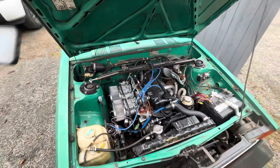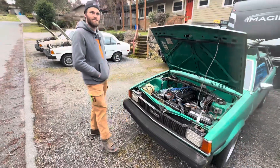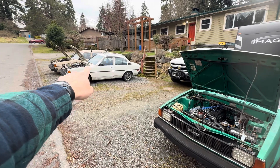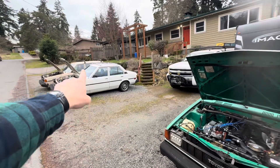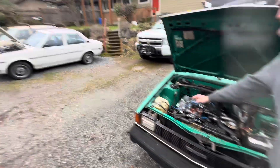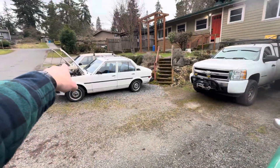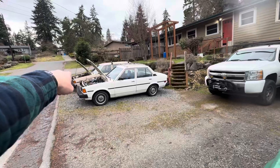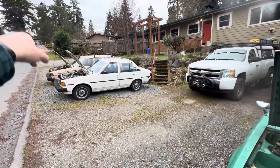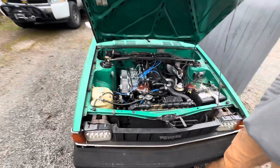Anyway, that's the rundown of what you can expect on the dyno — from a basically stock T-series with a tiny bit of bolt-on stuff, a nicely worked but mostly stock 3TC except for the camshaft and carburetor, and what you get if you go a little farther. Worth noting: all three cars are running stock igniter units with MSD coils and stock distributors. The stock engine runs about 12 degrees initial timing; they're all around 34 to 36 degrees total timing by 3000 RPM. The tan wagon and the liftback have a working vacuum advance; the sedan does not.